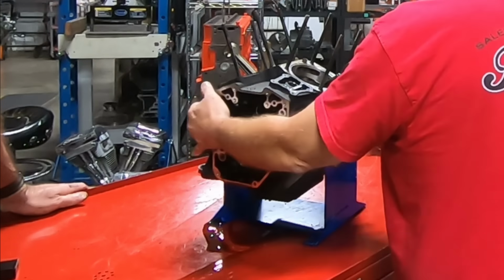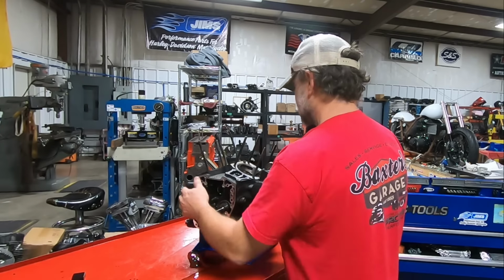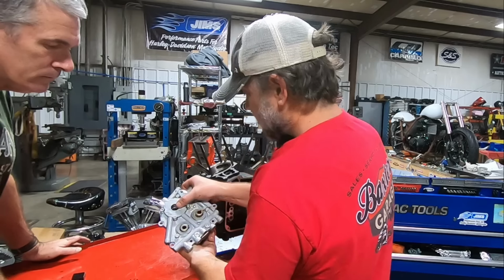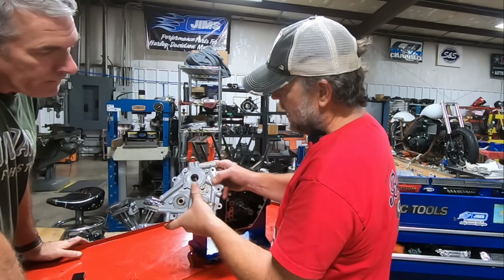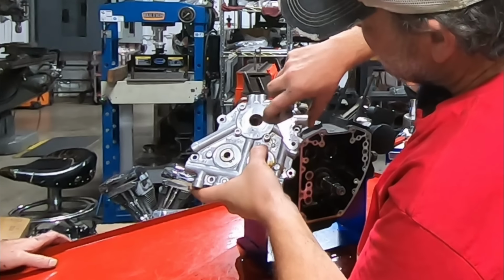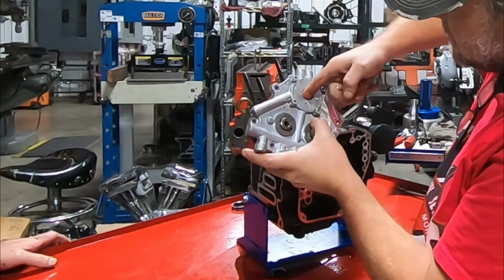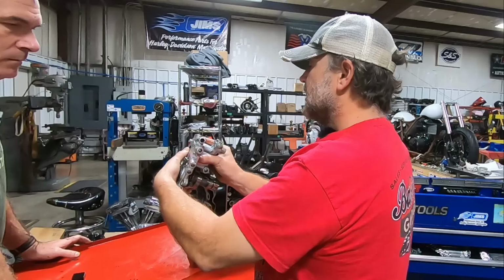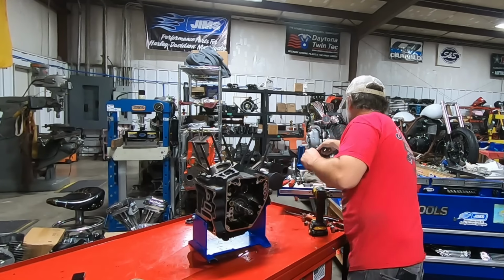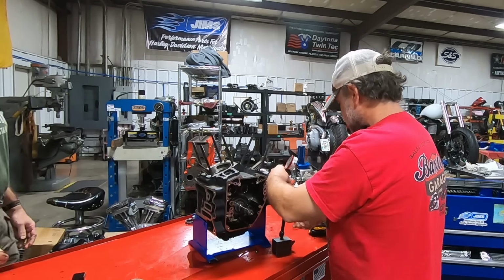All right. Now the cam plate, we noticed on the pinion of the cam plate. Yeah, let's grab it and we'll take a look. Another clue is how bad this is mushroomed out. Now, I may get surprised on this one, because if I feel here, I can feel a pretty sharp edge right there. The hole itself doesn't look elongated, but you can see there's excessive wear a little bit on one side. See that? Yep. So there's a red flag of a crank run out issue. So we may have very well had a combination of a couple of problems on this thing.